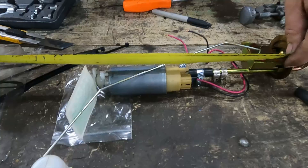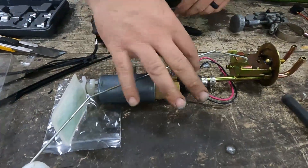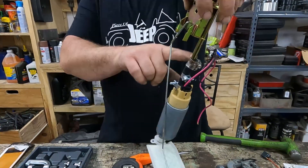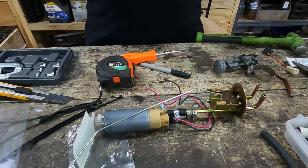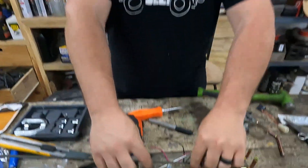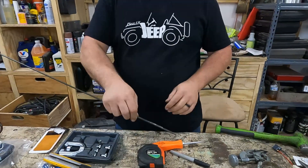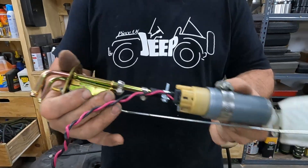11 and a quarter to the very bottom of the sock — clamped. This is probably rigid enough but I'm going to add a brake line. You could use whatever — I just happen to have a steel brake line. It's not super rigid but with two clamps right here and another clamp right there in short sections, it's going to be pretty rigid and will keep the fuel pump from swinging around in there. There we go, it's not going anywhere.